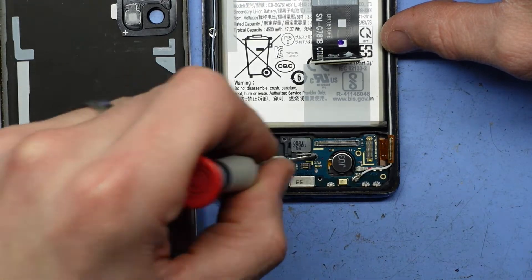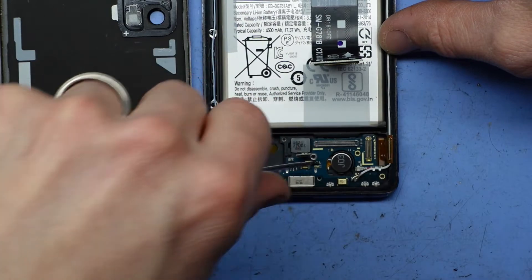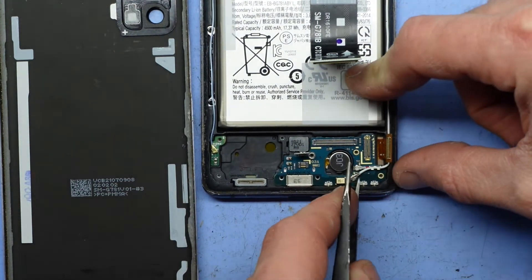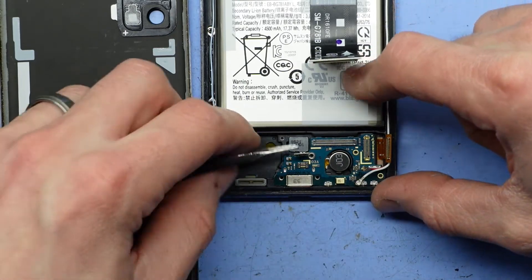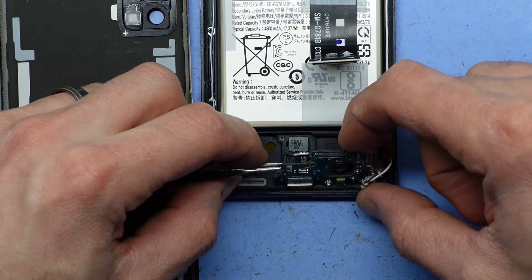Right here, this one will be different to the rest of those screws that we just removed. The black ones — the black one is for the main board. The antenna connections need to come off. Flicking them up usually works. Red goes under white, and from there lift up.